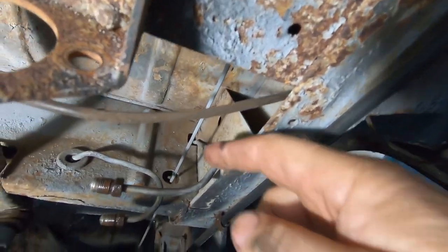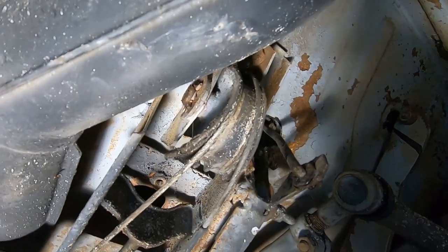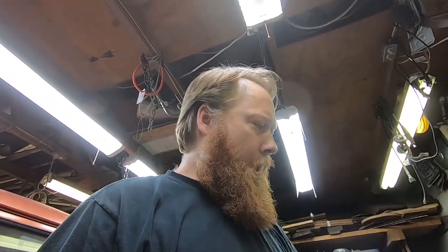I need to do some other guide tubes — like for the accelerator, the clutch cable, and maybe the e-brake cables. I've got some smaller tubes I want to clean out, and I think the cable trick really shines on the smaller tubes. The pot scrubber idea worked a lot better on the big tube, but I won't be able to fit that down into the small tubes, so I'll have to change my approach. Until then, I think I'm going to call it a night — thanks for watching, y'all.